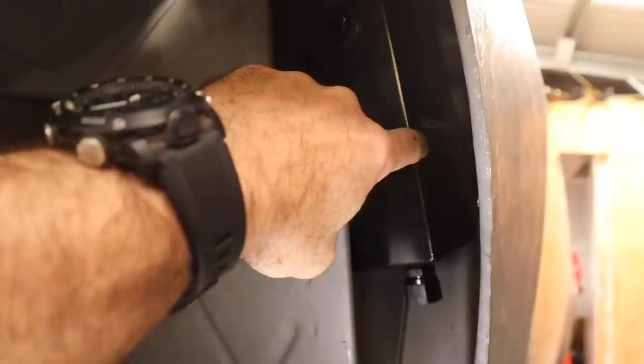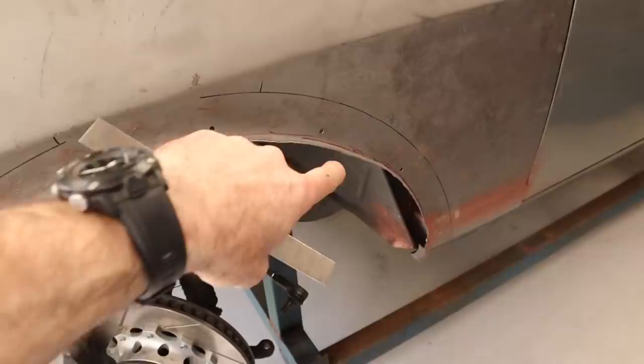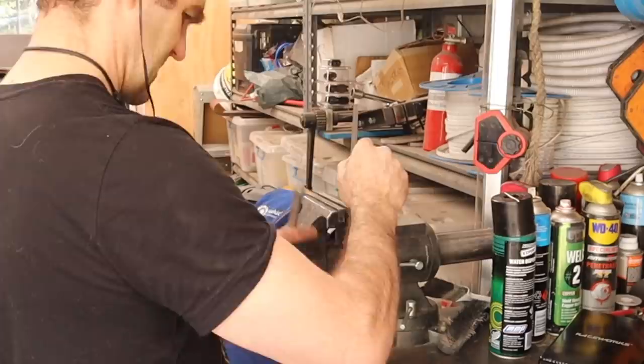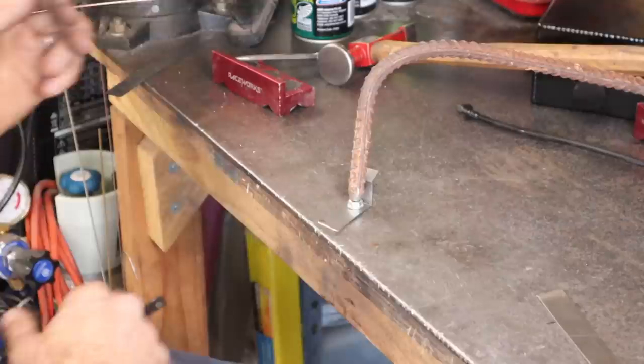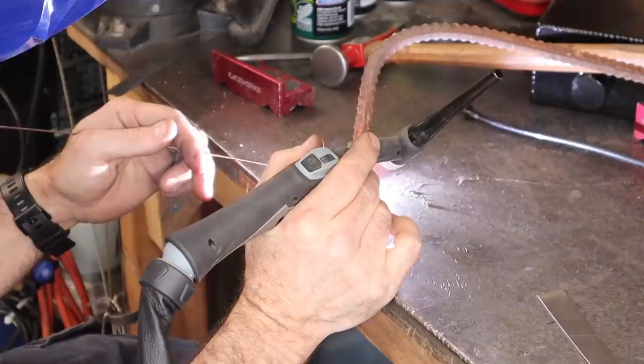It's hard to see, but the tank is in here now. I've drilled one hole on the far side and it's pivoting on that. On this other side, I need to build a tab to bolt to that spot — so I'm going to bend this up now, weld a captive nut into it, and make my mount that I can weld onto the inside frame of the car. And there we have it — our mount is all welded in.